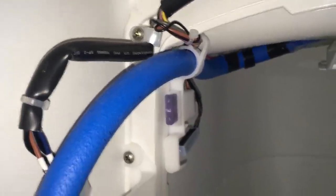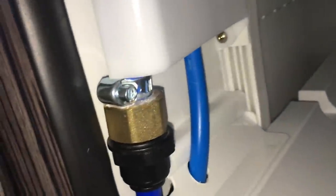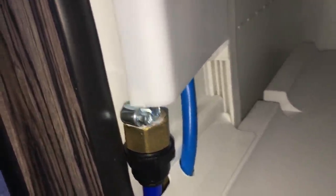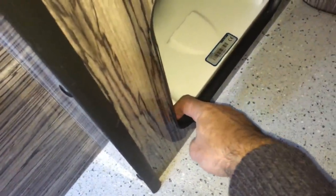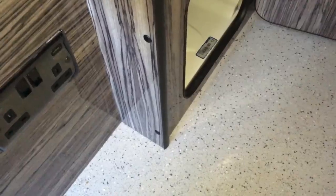So here's where the problem is — this is inside our Thetford cassette toilet. There's this blue hose which fills up the cistern, and that's connected to our LDPE pipe with an adapter. The only way we can connect onto that blue hose is with a barbed fitting and a jubilee clip, and that is where the water's coming from. This is the only jubilee clip joint in the entire van and it's the only one that's leaking out of all the other joints. We can't leave this unattended because water dripping inside the toilet here is going to get underneath the tray, run throughout the van, and get into all of these bits of furniture board — we'll end up with a world of trouble.